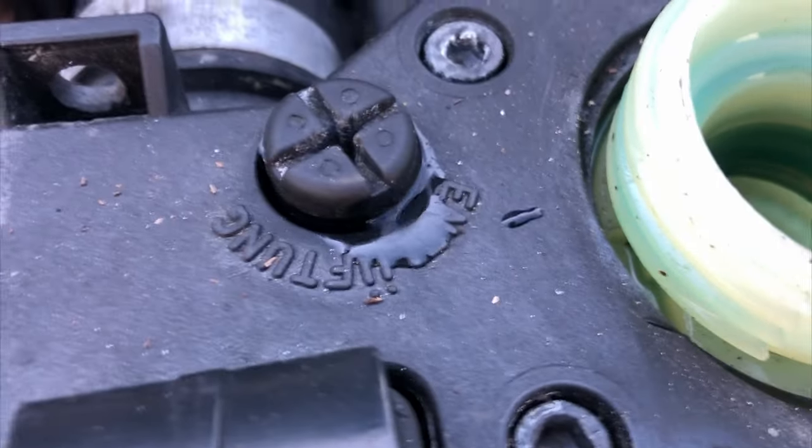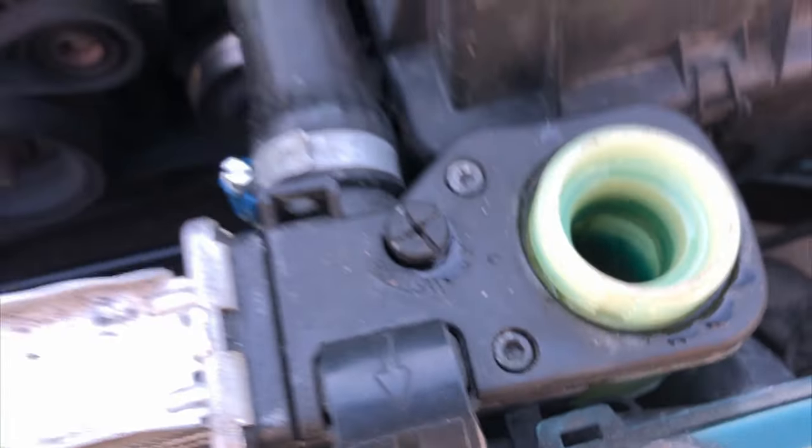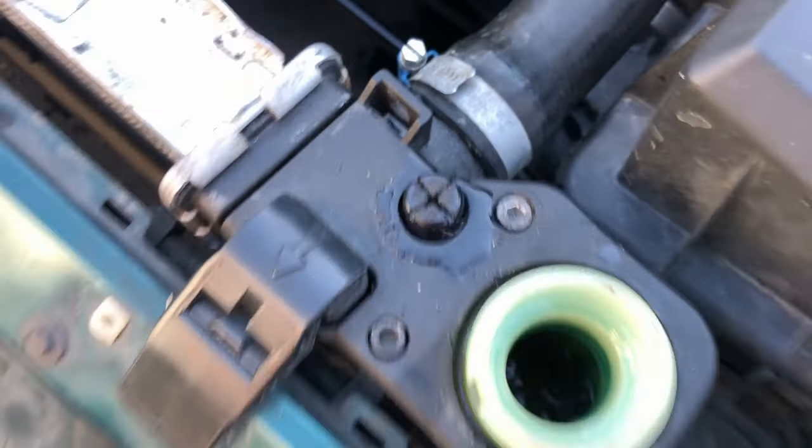The coolant reservoir is drinking up. I kind of had an oh-shit moment — I looked down and there's just a bunch of coolant — but I'm pretty sure it's just fluid coming out of the bleeder screw. There are still air bubbles coming out, so I'm going to let that keep going. It's just the bleeder screw — we're good. I'm so happy this is done. I've spent way too much time on this and had to take that thing apart like three separate times.